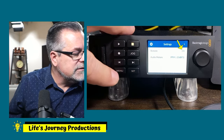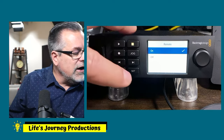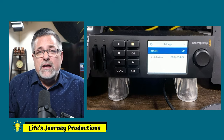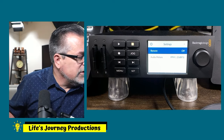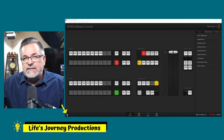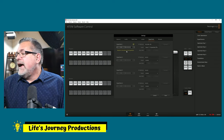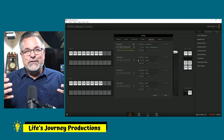Go over to page 4 — you need to have Remote set to On. I'm going to hit Set, then click Off, and hit Set again. Now my HyperDeck is set to Off, so it's not set to remote control. Let's pop back to the control software settings, and now you can see a little yellow warning — it actually says Remote is not active on this HyperDeck, so it even tells you what the problem is.